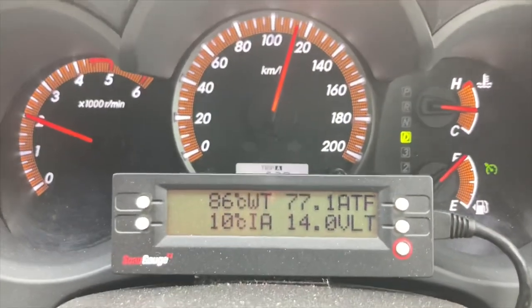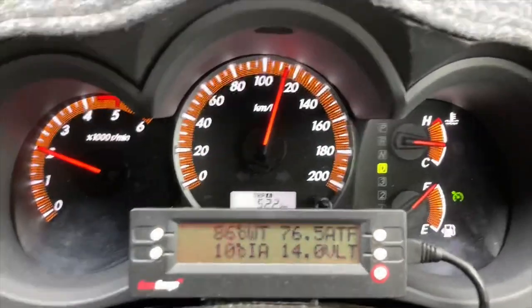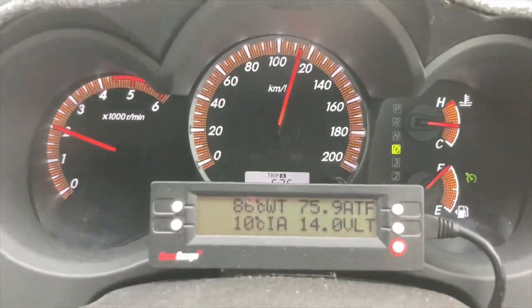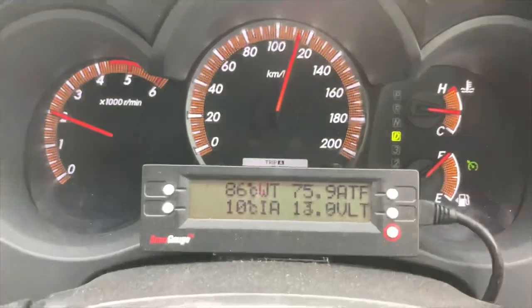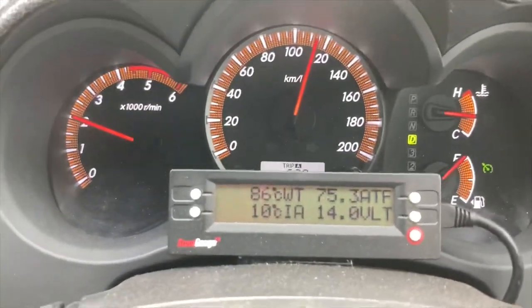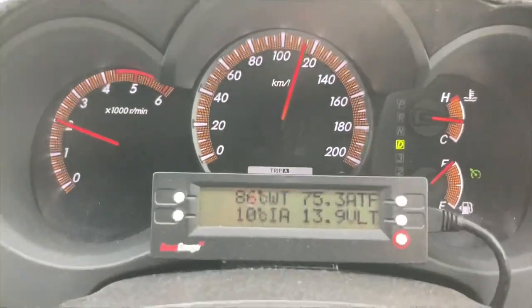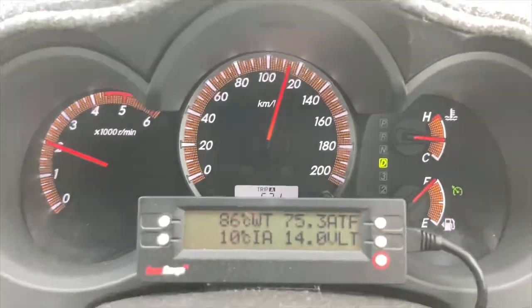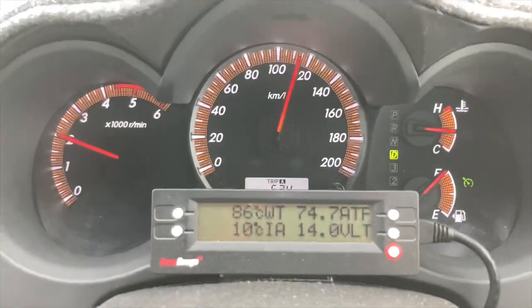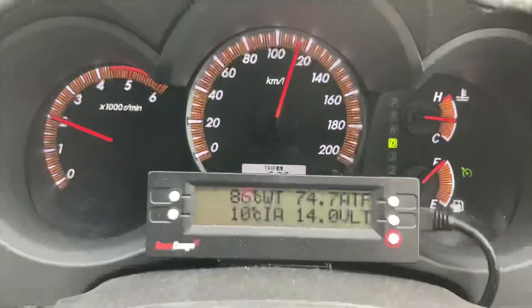It's the air on the pan cooling the transmission further. At the moment, 76, steadied off around 70-ish. So now we know the ATF temp — it's not dropping rapidly anymore. Rapidly up, rapidly down — torque converter manipulation. Steadied off a fair bit — that's our pan temp at the moment, about 75. Remember the Prado from the other video, the 120 — the pan temp was about 75 a lot of the time, then after 5, 6, 7 minutes of cruising it came down to 69.